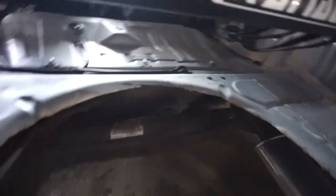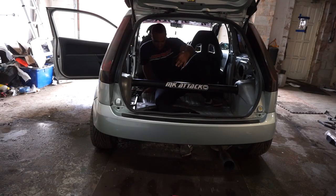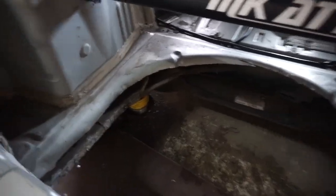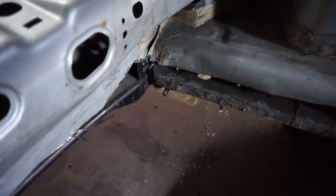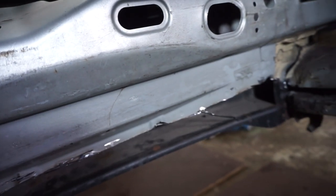I think I can probably sit inside there now. The next step is to clean it up with the flap disc, make sure everything's nice, and probably put a bit of primer on so we don't get any rust - like right there, that's the rear bash bar. What I'm going to do now is put the cardboard on, draw a template, transfer that to the plastic, and get that all stuck in.